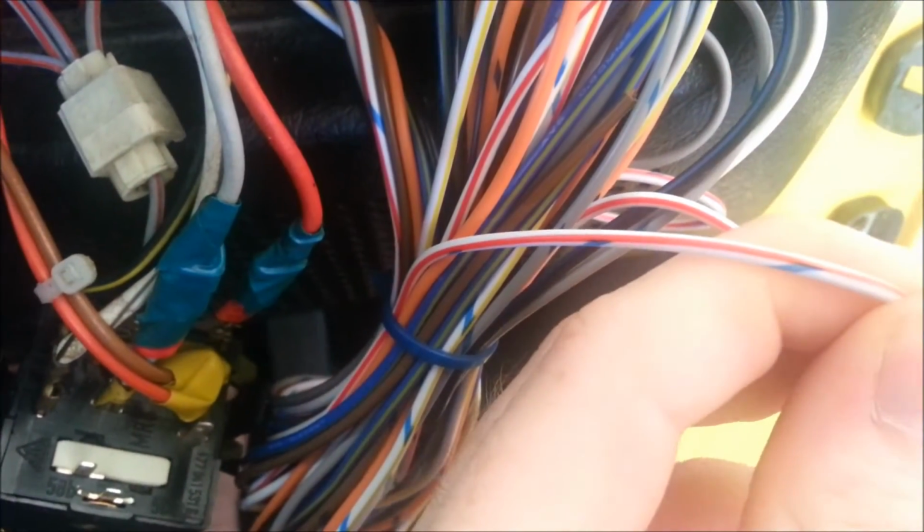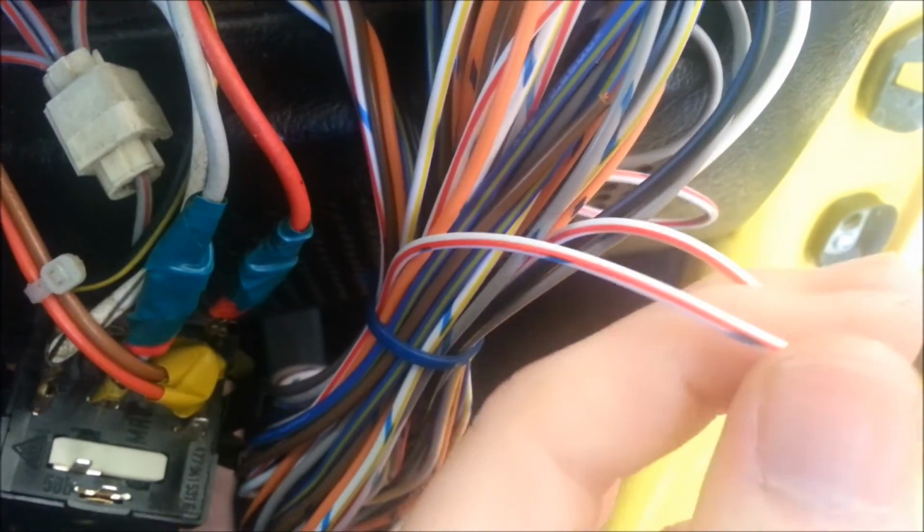this red and white wire here, in my kit, is the boot release wire, so I don't have anything to connect it to at the moment, but in the future, if I chose to get a boot release out of another car or a generic one, which I know Joel over on SBO has done, you can connect that up to the cable mechanism that already releases it. If you get one that's, you know, a cable thing and connected to a solenoid, which has wires on the other end, then you can connect this to it and release it with the system.